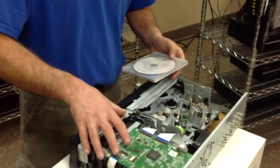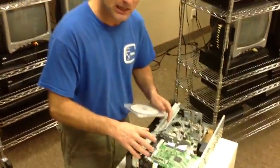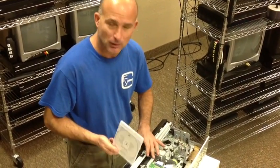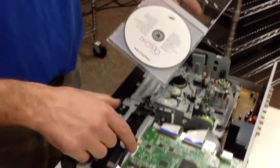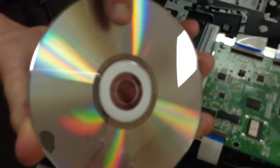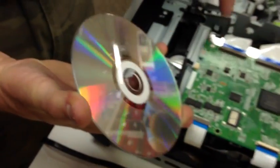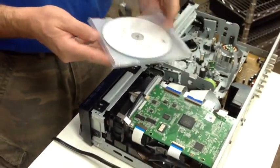You're going to get to a point where you want to clean the DVD recording side. Generally if they're really bad and they don't read the disc, the board's got to come off and you've got to clean the laser lens, but most of the time the average person can't do that. But there is a quick fix — it's called an optical disc cleaner. It's got little brushes at the very bottom that sweep away any debris off the lens so the lens gets clean enough for proper playback on your DVDs. This one here is a really good one by Memorex — it's called OptiDisc. A really good disc to buy for DVD cleaning; recommend them highly.